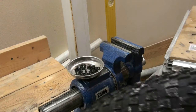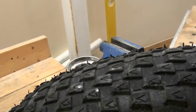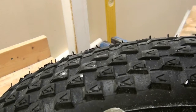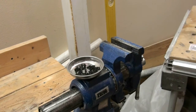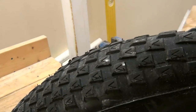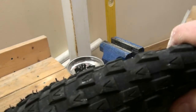This is the tire we're starting with. It's not a real deep tread — it doesn't have a lot of knobs on it. A quarter inch is really about the maximum for the set screw length. You don't want a set screw any more than a quarter of an inch, because that's about all the rubber you have there. Any further than that it's going to get into your tube.